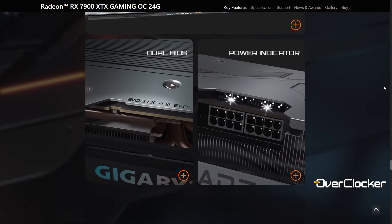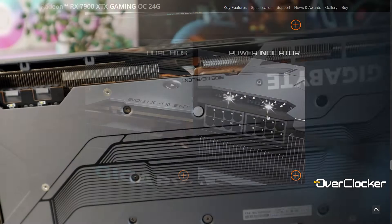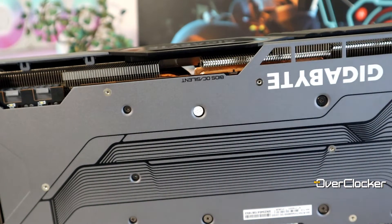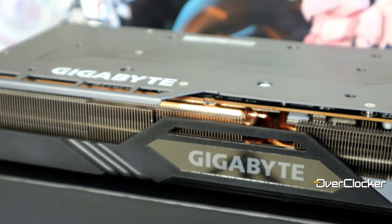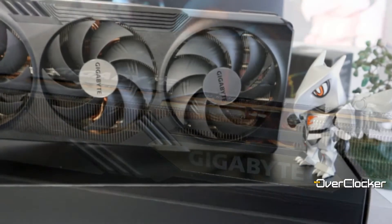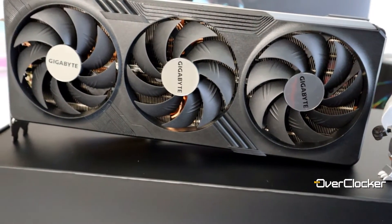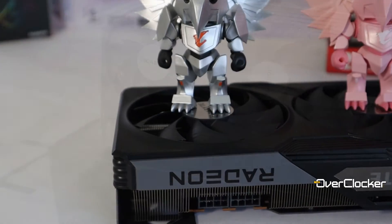This should fit in a lot more cases than the Elite model or other brands with larger cards. The Gaming OC features a dual BIOS option — one for quiet mode and another for performance mode. I tested the card in quiet operation, because the performance BIOS didn't add any useful performance and all it did was increase the noise substantially.